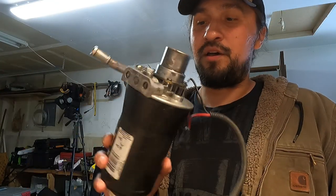So you need all of those things for combustion. You need heat through your fuel heaters, through your glow plugs, through your compression, and then, if you have it, through your intake heater plug, and that will create a nice hot situation so that your fuel will fully combust, not just shoot out your tailpipe. So that's why I added back on my housing.